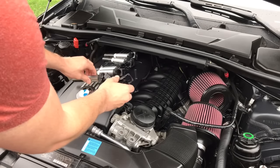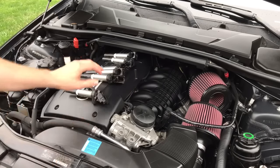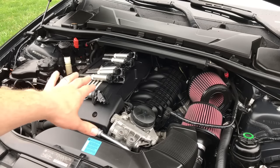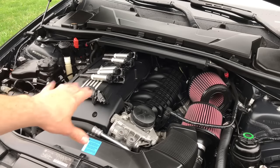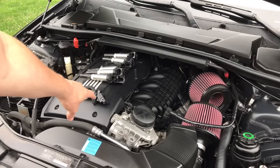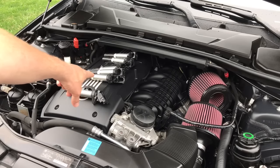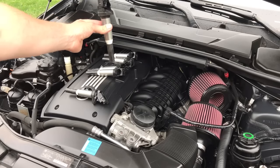Now, remind you that you're going to need to delete that code so you start fresh. Delete it, then after doing the swap, start your car up again and see if the cylinder number one misfire follows to cylinder number two. If the misfire follows to cylinder two, then you know you have a bad coil, and you want to go ahead and buy a new coil.